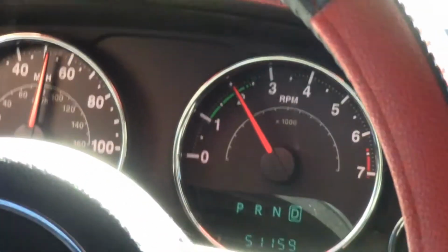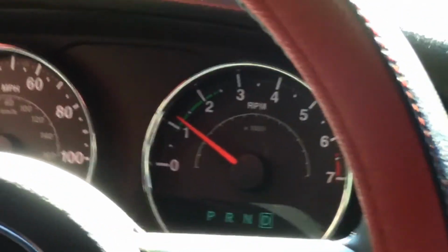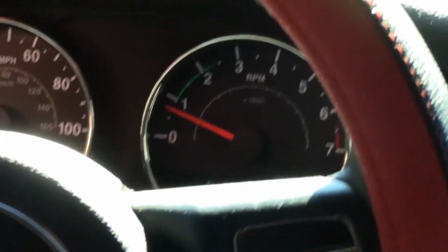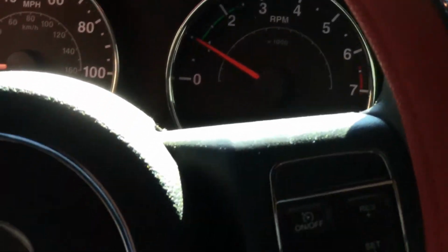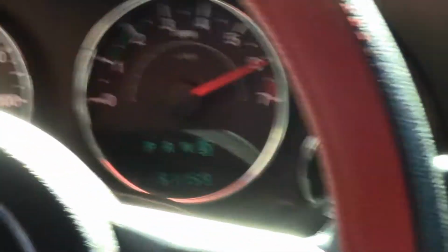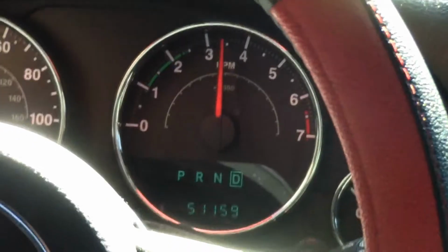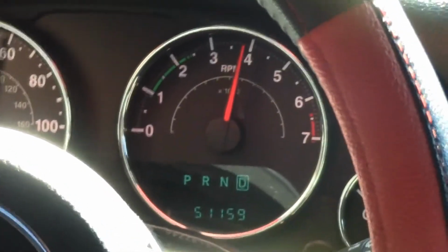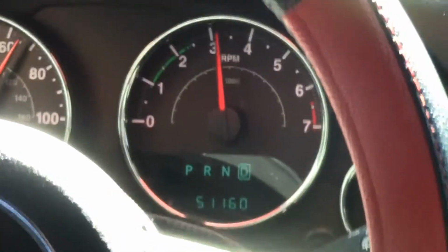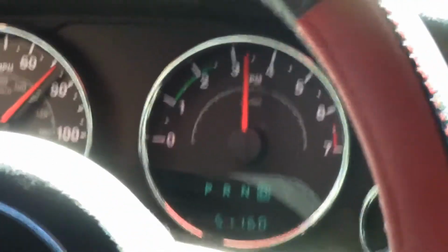I'm going to try to stop here again. We've got a slight downhill ahead of us. I'm going to be a little more aggressive on the throttle, and the shifts are going to occur later. This is how we have the TCM programmed. So I'm going to go about half throttle. Shifts 1st to 2nd, 2nd to 3rd. I've left off the throttle now. There's 4th gear. Might hit 5th. We're on a slight downhill, going about 70. There's 5th gear.